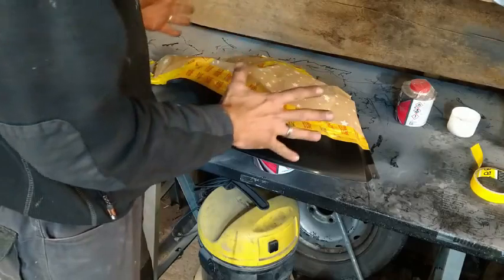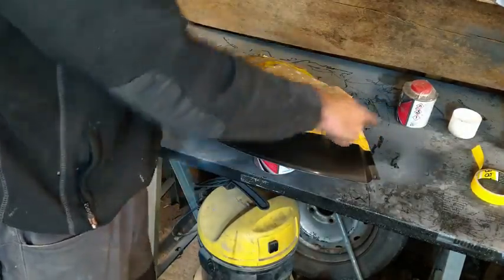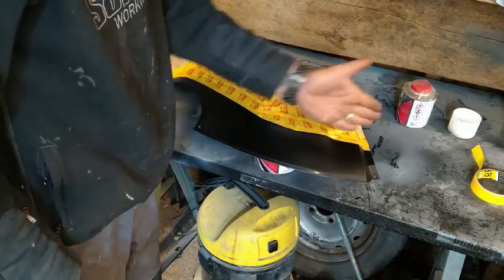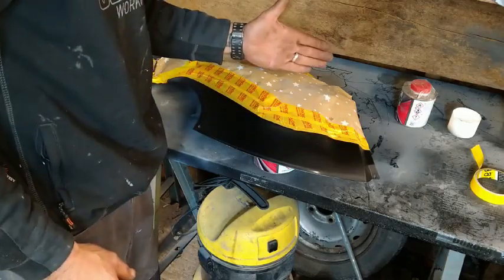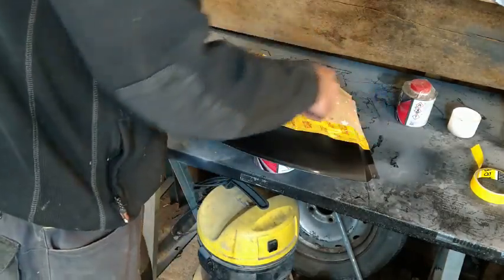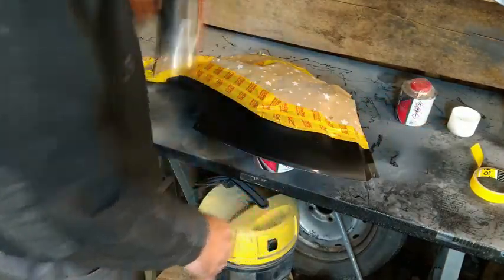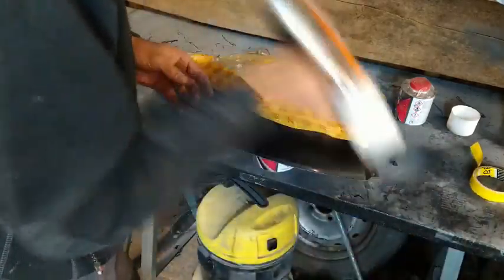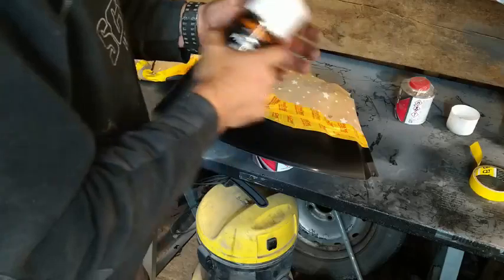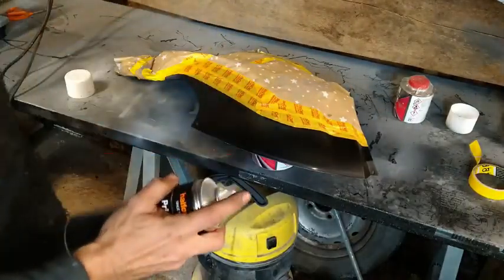Okay, so like I said, we're doing a bespoke paint job and everything is black that I want black. I've taped up. I wish I had some pinstripes that I could just do that with. It would have been easier. Anyway, we're doing two tones, so this is going to become pearl white and gloss black with an M3 Motorsport triple stripe running through that. So whenever you're spraying white, always white primer. Probably 3 or 4 coats. It'll just save on the actual white paint.